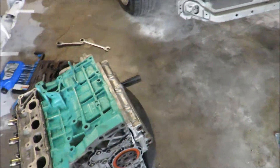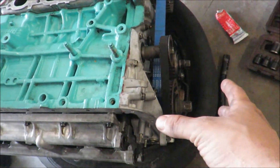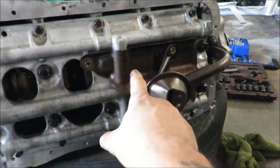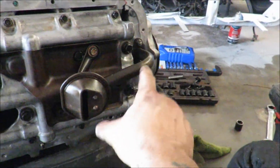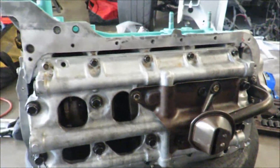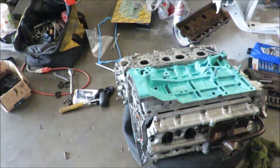The seal I put on last after the plate is on so it's more stable. Put oil around it, push it in, go around with the mallet and tap it in, then use an extension and go around all the way. It pretty much stops when it's completely on — there's a little rivet on the other side and it just sits there. Now throw some RTV on the pan, slap the pan on. That's pretty much all I can do right now. The timing cover, I want to do that too but the one I have here at the shop is all messed up, I forgot to bring the good one from the apartment. Alright, the cradle plate is on, pickup tube is on, all tightened and torqued down. RTV'd up the pan and threw it on — should be pretty much good for today with this thing.